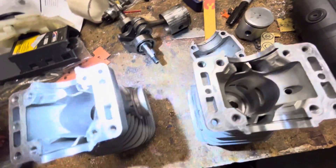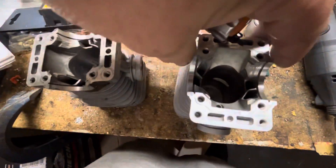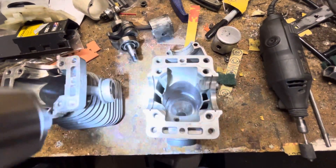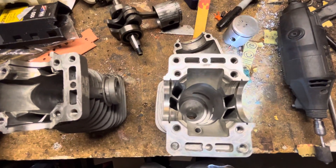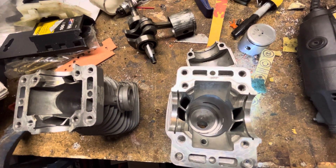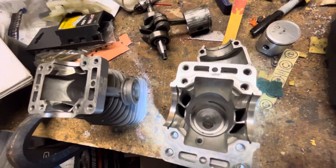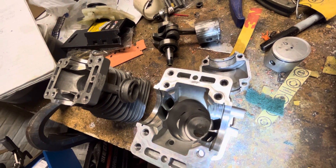Here's your intake over here - you can actually see, hopefully, straight on here. The exhaust port is off on an angle, and the same thing applies to the transfers - they're actually quite odd in that they're twisted in the bore.